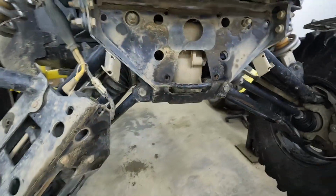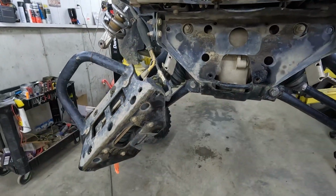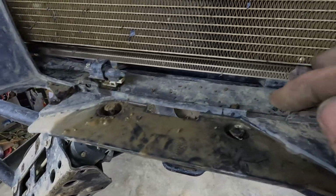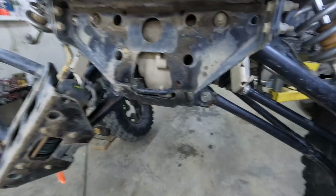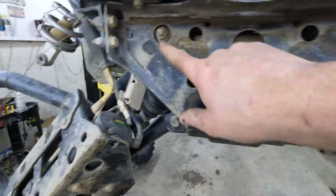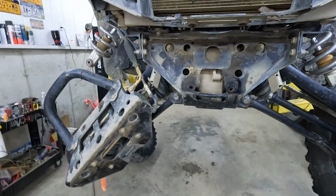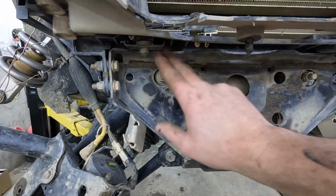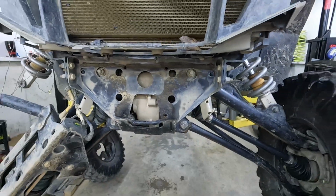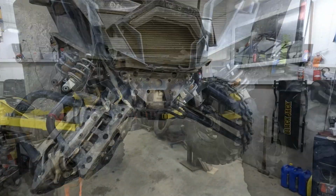That is quite an assembly hanging over there by a wire. There are 2 little push pins up here. I had to pull those out. Would have been nice to know before I got the bolts out. And the top 2 bolts feed through the nuts, so you got to hold the back side of them. But with that gone, looky there, I've got clean access to that front mount. So I'm gonna pop that off real quick.